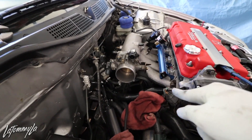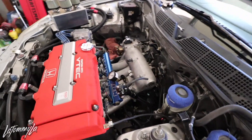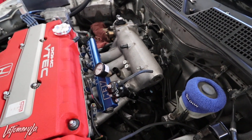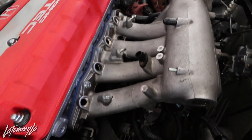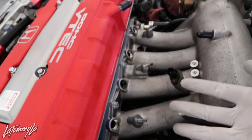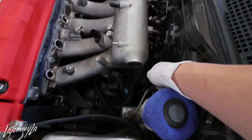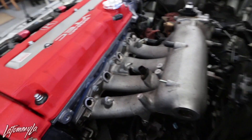We should be good getting there. I need to get some food after this — kind of hungry — not rushing to install this but really excited to hear it start on the ITBs. So I decided to take off the injectors and the fuel rail because it's a lot easier to access. Now I'm just gonna take off the six bolts on top and I think there's four underneath, and it should come right out because I don't have anything else connected to it — just the harness underneath and a few return lines right here.